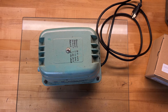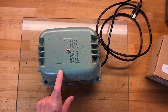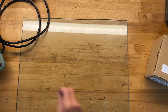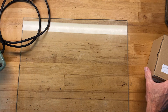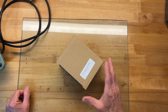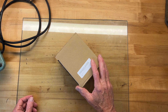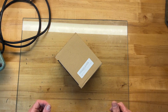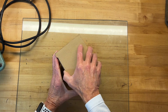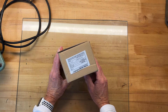My first tip is that in my experience these things last about 18 months before they need to be rebuilt. So what I did is put a reminder on my calendar 18 months after the last repair to buy a repair kit. I bought this kit three weeks ago, and today the pump died — so 18 months seems to be pretty accurate. Think about going ahead and ordering a kit about 18 months after your last rebuild.